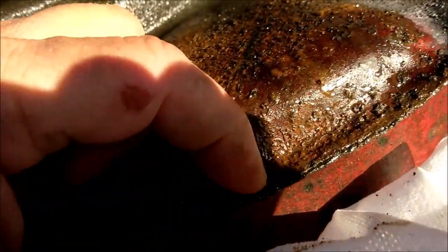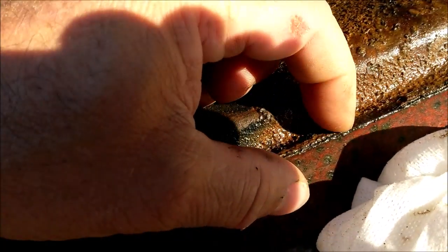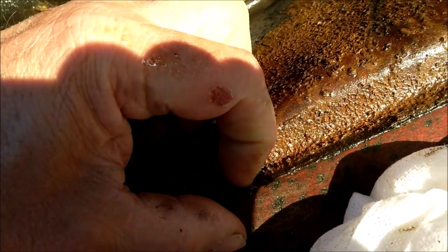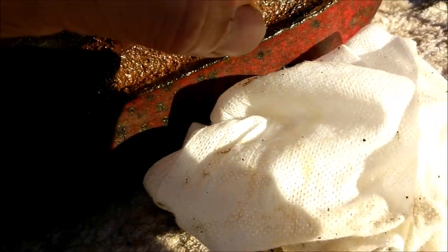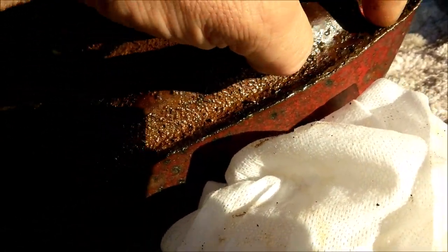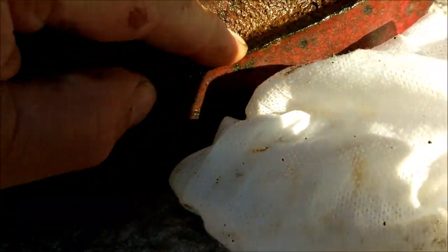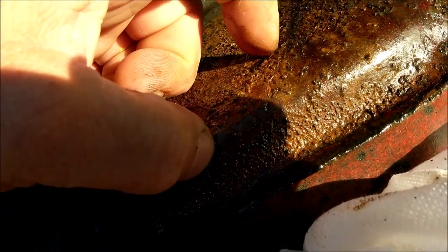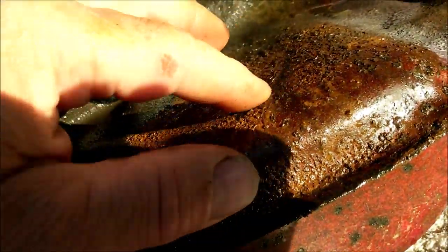This stuff here is actually sticky. Look, it's sort of like wax. Waxy stuff. So if I could get that off first, I probably should have done that first, shouldn't I? But I've tried soaking it, and all different stuff. I thought that might have gotten rid of it. So all these little bumps, they aren't rust bumps. They are literally waxy deposits. And underneath, see, this is the petrol that turned to varnish when the tank gave way.